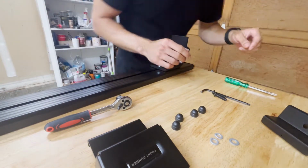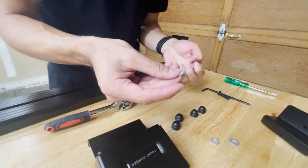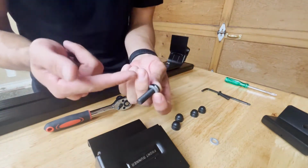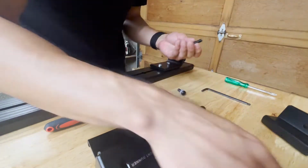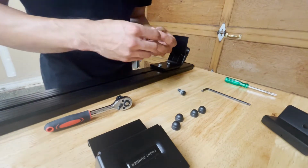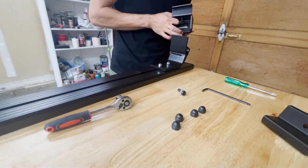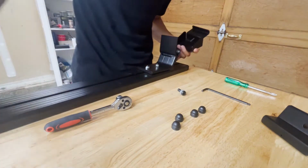And the last thing we're gonna do before we go out there is getting these ready. So you got the spring washers and you got the flat washers. The spring washer first, you're gonna go spring and then flat, right? So that way this locks it in a little bit more. And I'm only doing this because we're almost done with the install. So here we go. All you're gonna do with this is it's gonna go here and lock into that thing that we put in earlier. And that will happen on the gutter, which I'll show you guys out on the car.